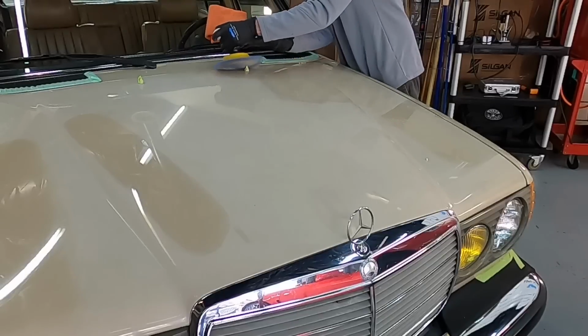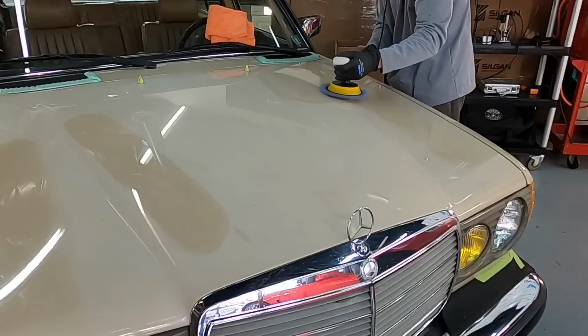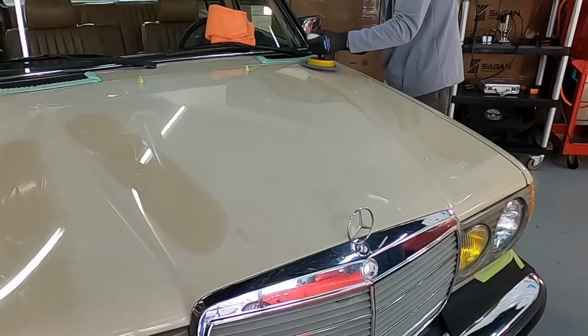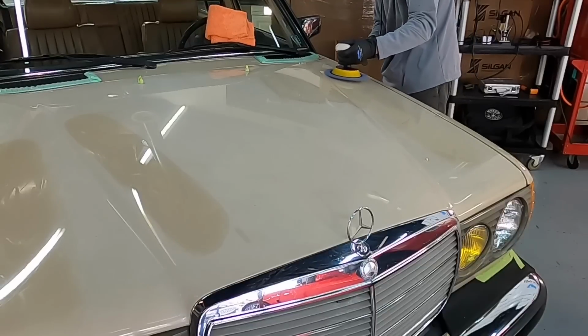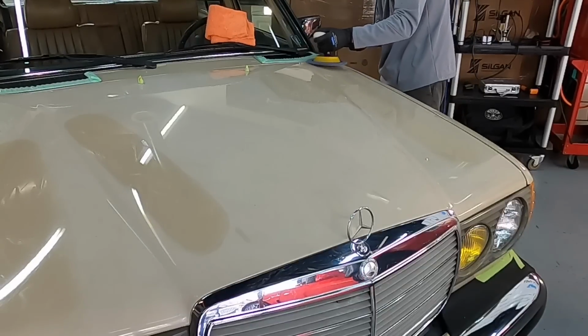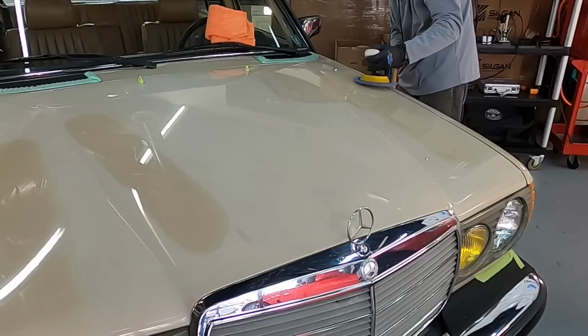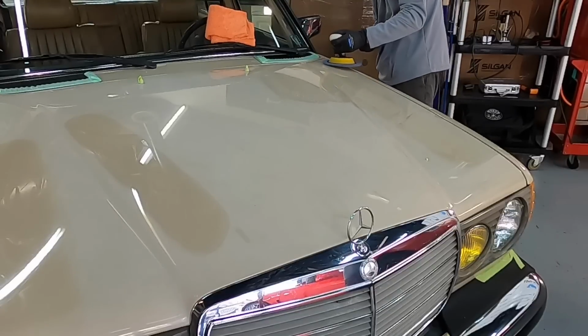When used properly, the rotary is exceptional for cutting and finishing. So smooth when you learn how to use it and get a little bit of experience behind the tool. I often hear stories of the tool skipping. If it skips, just slightly tilt up on a 10 to 15 degree angle and then gently lay back down again, and it will glide along nicely.